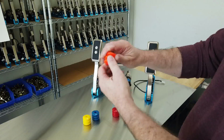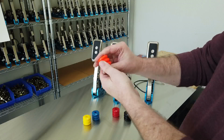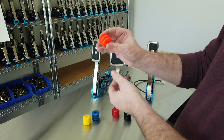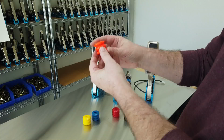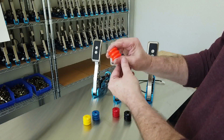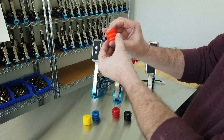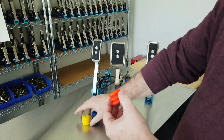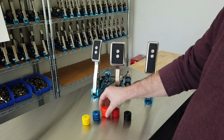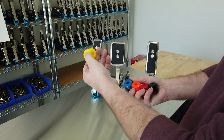I've tested many different bumper materials. I've always found that polyurethane was the best, but it's a material that's very hard to work with. It's hard to cut. So having custom molded allowed me to basically do what I wanted to do, which was use polyurethane for a material. And the way the profile works, of course, it's like a little progressive feel to it. And with 5 now instead of 2 hardnesses, you have a wide range of adjustments. So those are all new. These are completely retrofittable and can be used on the PRX units as well.